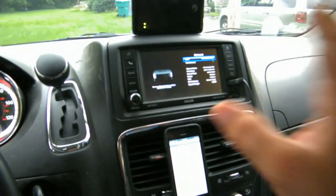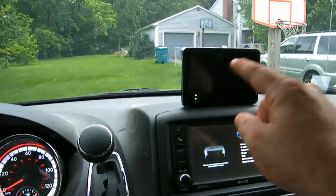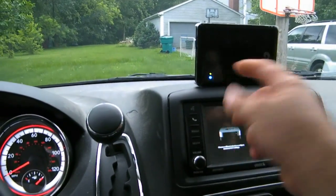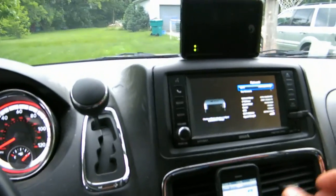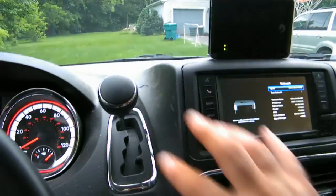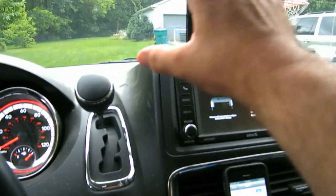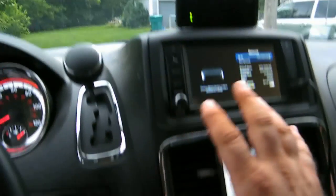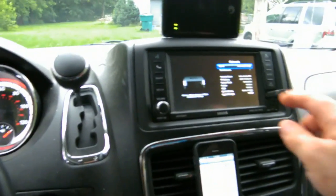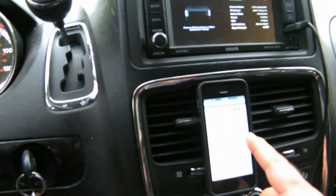What I'm going to do today is connect the Apple TV and the iOS together using the Wi-Fi that comes from this portable drive. This Wi-Fi is meant for you to use the app on the iOS device so that you can stream all the media on your GoFlex right to your iOS. But today I'm going to set it up so I take content, put it on the iOS, and AirPlay it right onto the Apple TV — connecting both the Apple TV and iOS to the GoFlex Wi-Fi.